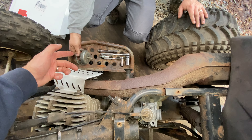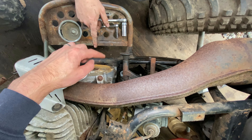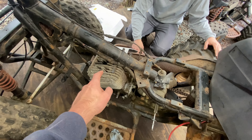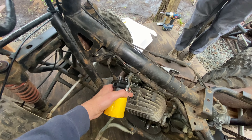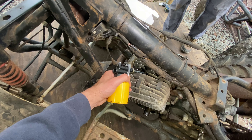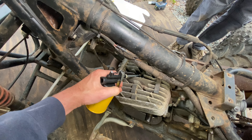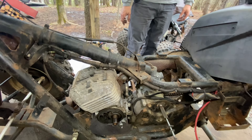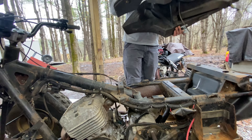We don't need that for the test start. We've sealed that in with RTV so the bendix doesn't have any extra pressure on it when we actually run the starter. We've pulled the plug here — this is just some 10W-30 — just to make sure our cylinder is oiled. Probably a little more than I need in there, but just to make sure. So let's get our tank set down and connect up our oil feed line.